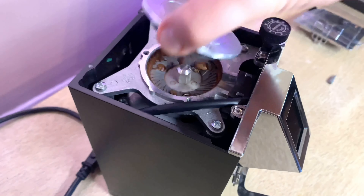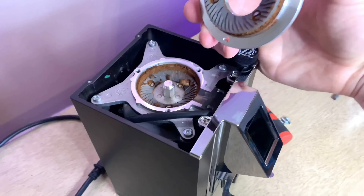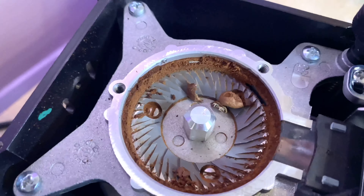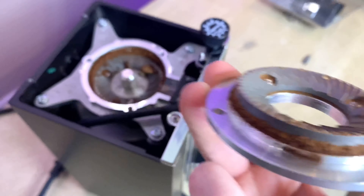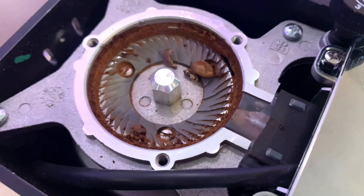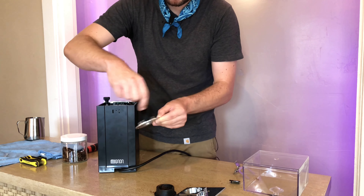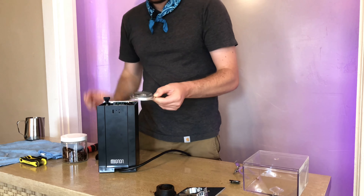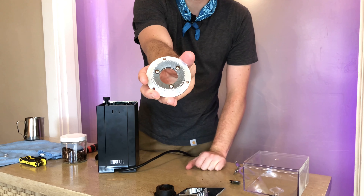At this point you've taken the top off and you will see three screws here that you want to take apart to get to that top burr. Take your screwdriver — they're pretty small — so first loosen them with your Phillips screwdriver and then go in by hand so as not to lose these little screws. You should be able to lift up your top burr just like so. There's quite a bit of grime in there, but nothing too bad — this is a fairly new grinder for me so it should be easy to brush most of that out.